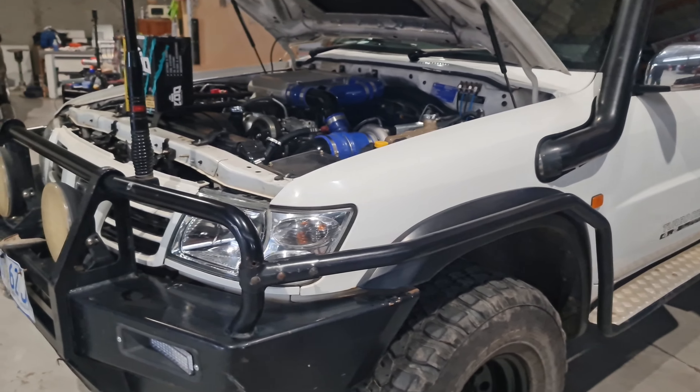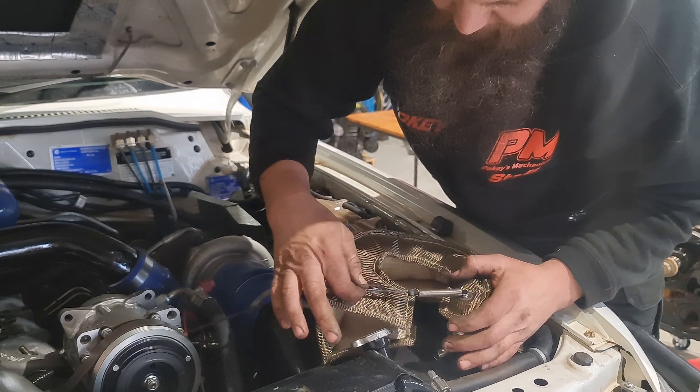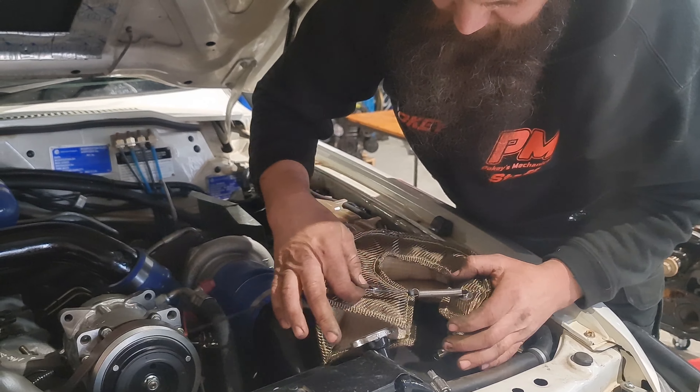I did say I'm going to use these cable ties - I'll work out which way this is going to orientate onto there. I'm going to put the spring on this side because we've got the heat shield there in the way. Have you guessed what the cable ties are used for yet? Clip the zip tie through the hook of that spring, like that. When we get it in, we can actually reach it because it's really hard to get under there to pull it tight and get it over onto that spring. Putting the cable tie on just makes it a lot easier for your installation.